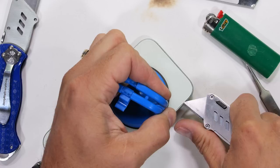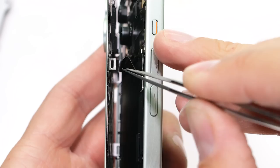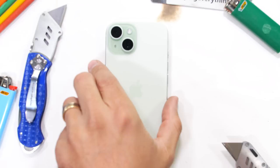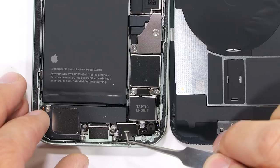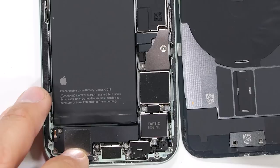I do like how Apple has placed the rear glass bracket right in front of the fragile ribbon cable, so as the cutting of the adhesive is performed, it is far less likely to damage the ribbon — thumbs up for that. I'm a huge fan of Apple's new repairable design. However, this repairable design is only designed to be repairable by Apple themselves, since each repairable component, including this back glass, is still software locked to the motherboard. But we are making progress with the right to repair movement. Interestingly, the bottom two pentalobe screws secure the back glass panel by stabbing far through the frame into little metal brackets on the glass — these little engineering details are incredible.